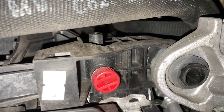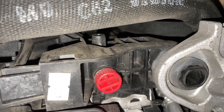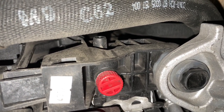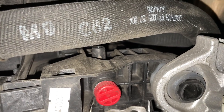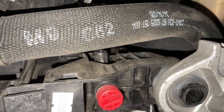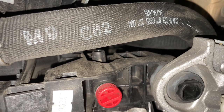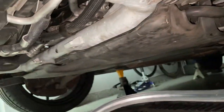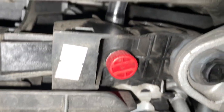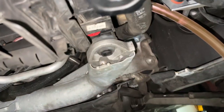What's pretty cool about the design is it's almost mess-free. Above the red drain plug there's a black attachment you can put a hose onto, so when you loosen up the red drain plug all the fluid comes out of that black attachment instead of the bottom of the radiator. It makes it pretty mess-free by just hooking up a hose and putting it into a bucket — pretty nice on a high-performance car like this. It looks like a three-eighths inch inner diameter hose fits perfectly over the attachment, pretty snug, so I'll route this into a bucket and we should be set to start draining.